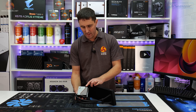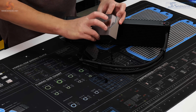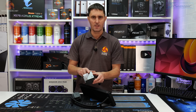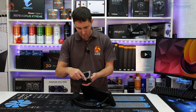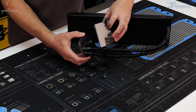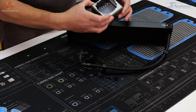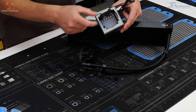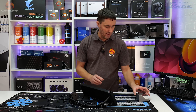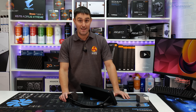On the pump housing there's quite a big and chunky top to it. It removes easily — just pulls off — and on here you've got several infinity mirrors, which reflect the RGB lighting effects in all different directions. The only problem I can see initially is that the cover has a cutout that fits a specific way on the tubing, meaning you can't actually rotate this cover depending on the orientation you have the CPU block installed, which is a bit of a shame. Inside there are LEDs for the RGB lighting with a standard 3-pin 5-volt ARGB connection, which will please users that don't like proprietary connections.